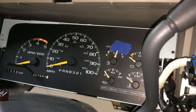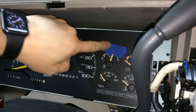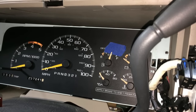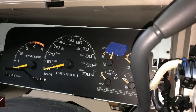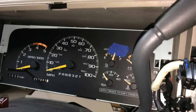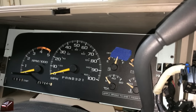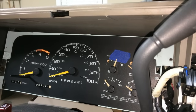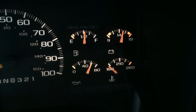Put the four bolts back in and put the front trim piece back on. Take the piece of tape off since we're done. These are air core motors — you can find them on eBay or possibly AliExpress. Just make sure you match the codes on the back: F for fuel, P for pressure, V for voltmeter, and whatever else you had. If you've got resistor packs like I did, follow the directions that come with the air core motor kits, or follow the tip from this video and transfer them over carefully — they're fragile, about 10 years old, and the middle piece looks ceramic.